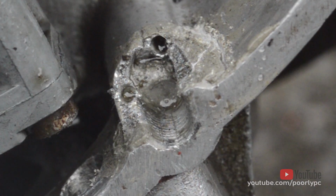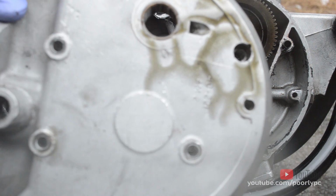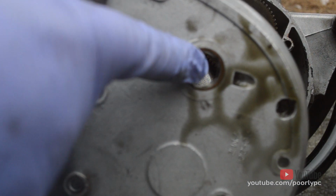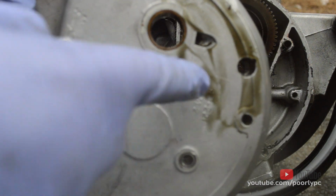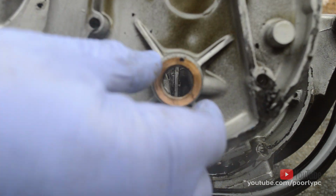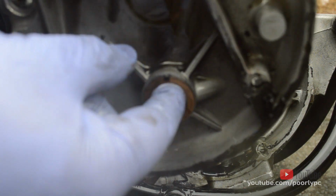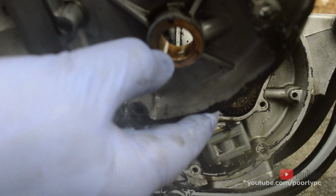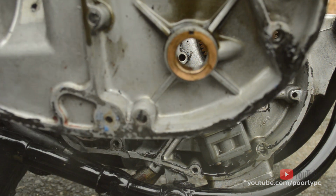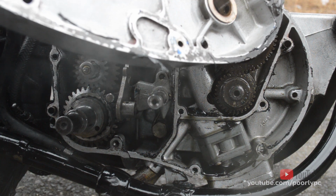that's the thing, matey. For those people that saw earlier the oil weeping out of the top, I can only tell you from mine because I've no experience with these bikes, but this brass bush here was the one that was forming the oil outside, and it's literally a press fit with a little locator stud here. When I check it, even with the human finger, and it's a wonderful thing how you can pick it up even with these rubber gloves on, it is worn in there, so I don't know whether these are available, but I'll be speaking to my usual suppliers.